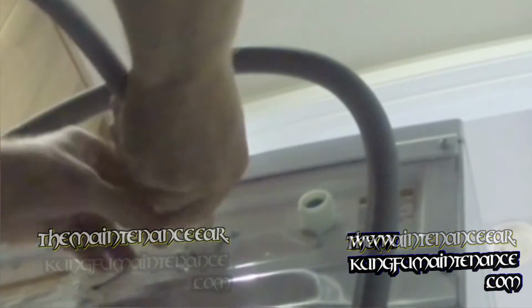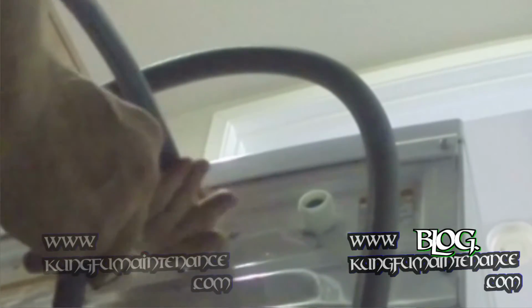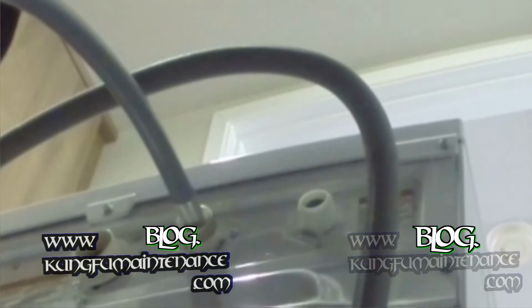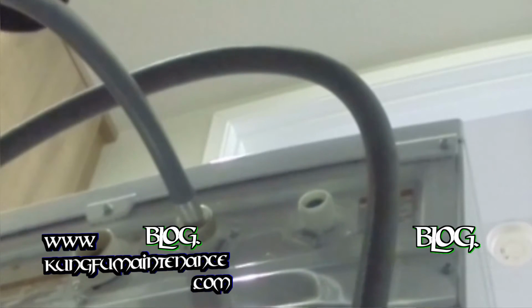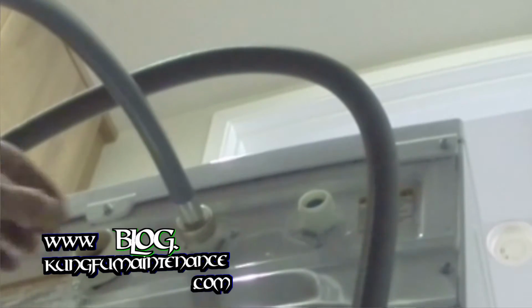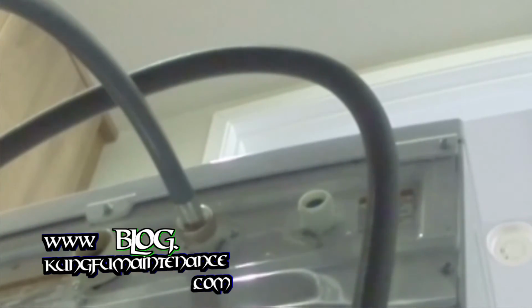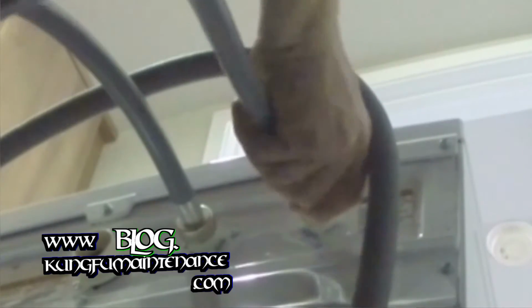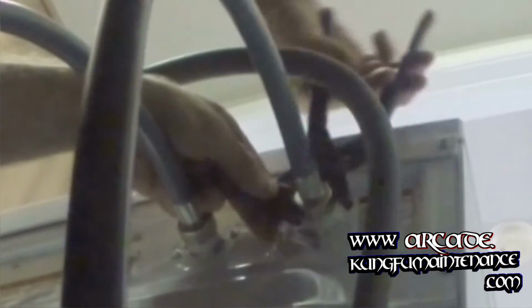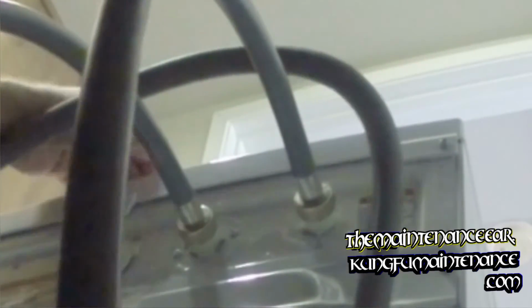This one's a little bit different. The hot side's on this side. Just made sure my gasket's in there. Okay. Cold hose, same thing, just making sure my gasket's inside there. Also making sure nothing's cross-threaded here. Get one shot here, and that's it. A little quarter turn past tight. That's it. These are plastic threads, so we don't want to get too crazy with it, just crazy enough.